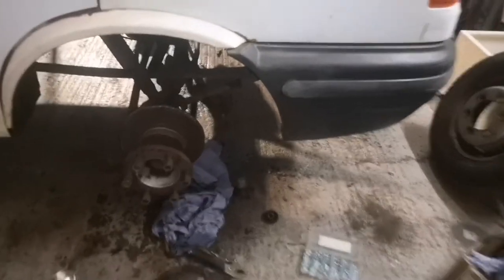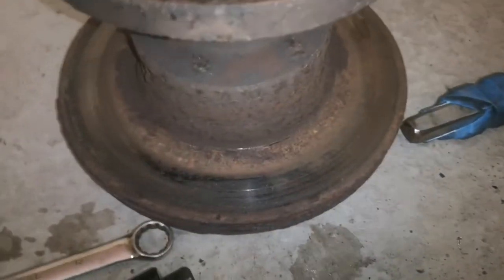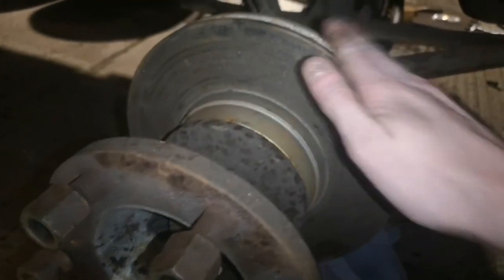The other thing I've been doing is rebuilding the front wheel hubs. The old brake discs were in pretty bad condition, and the calipers once I got them off weren't much better. I had to separate one due to a snapped bolt — it took a few hours to get out — which was the bolt holding the caliper onto the carrier on the van.